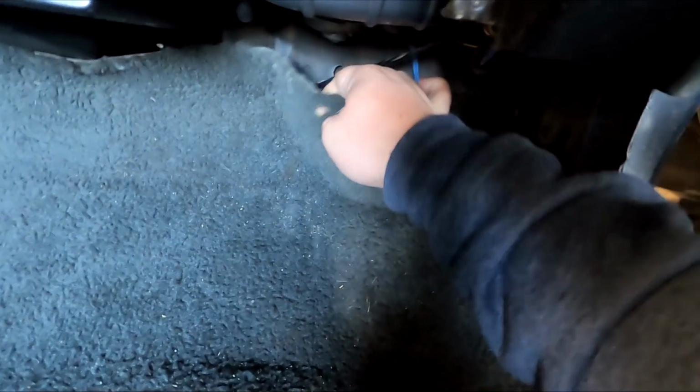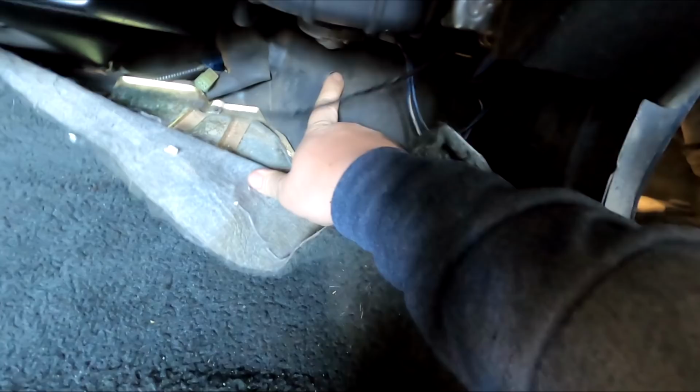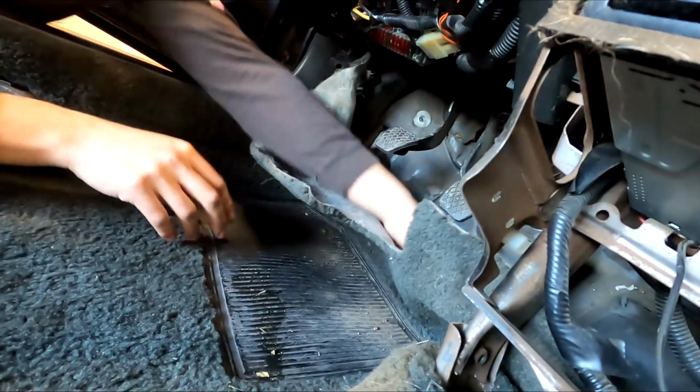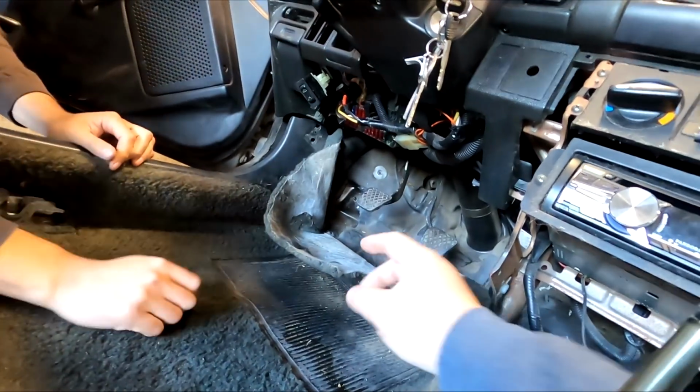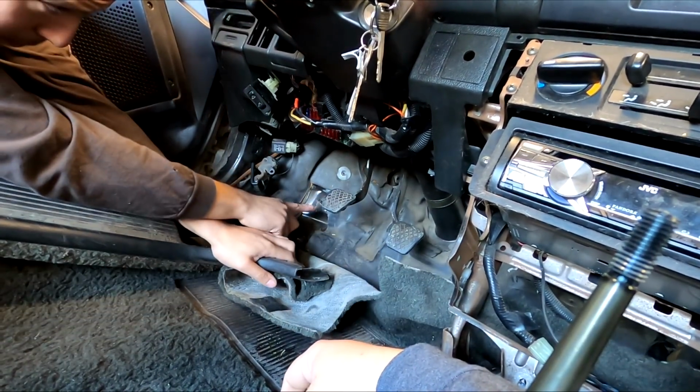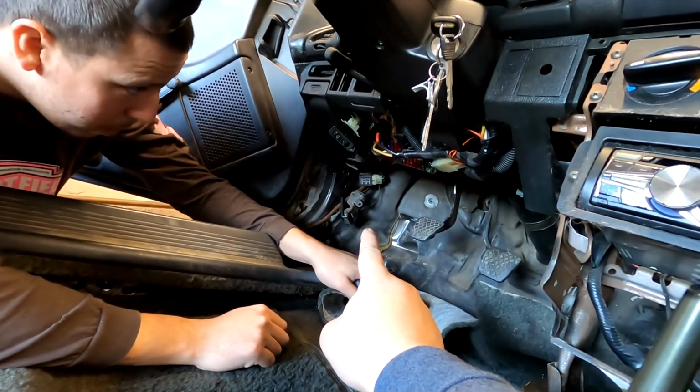He already did that. And then underneath the dashboard, you have a little screw-on knob that goes to the stud right here on the firewall. And then in the center has one as well. You can see it right there. That little one just came out right there. And then on the driver's side, there's a little footrest. You pop the little plastic off. There's 2 nuts inside, and then you got to take off the latch for the hood.